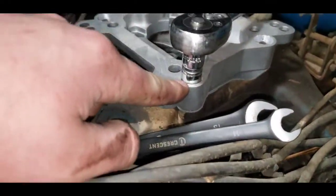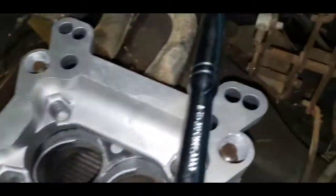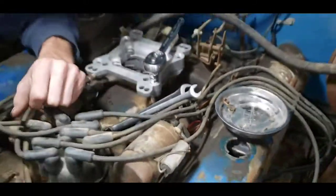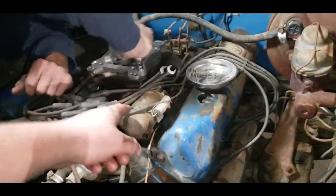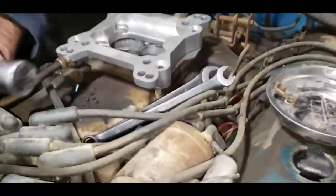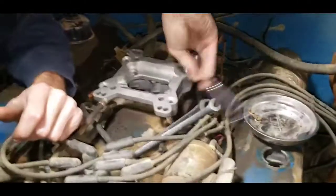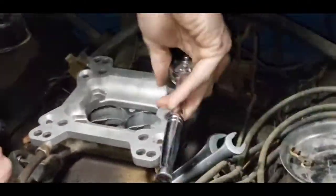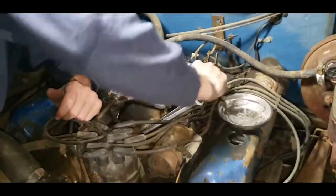Let me flip the camera around and I'll show you guys what we had to drill out. We did have to drill out every single one of these holes so we could get a socket to fit in there, because originally it's meant for a bolt to go all the way through, and it has a bolt head style flange at the bottom, kind of like a socket would if you flipped it up, so it would hold tight and you wouldn't have to hold a wrench on it. We didn't have any sockets slim enough to fit in there. By the time we ground on a socket, it would be open on all the ends and it wouldn't work. So we just took a 5/8 drill bit on my little Bauer Harbor Freight drill with a Milwaukee drill bit that costs almost as much as the whole drill, to bore out those holes and get everything quote machined unquote to the correct size so we could install this.